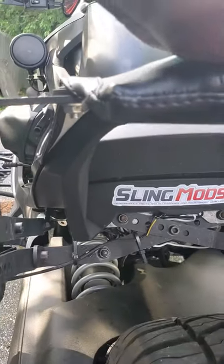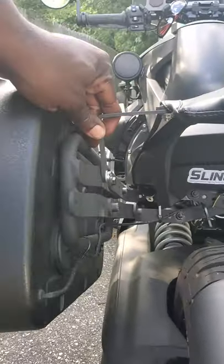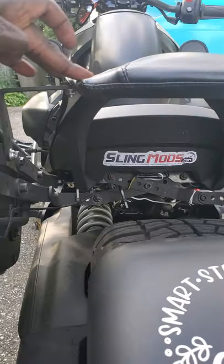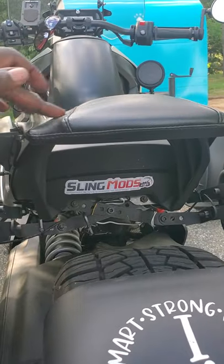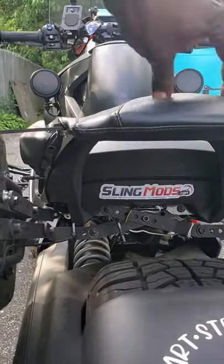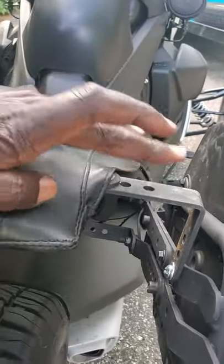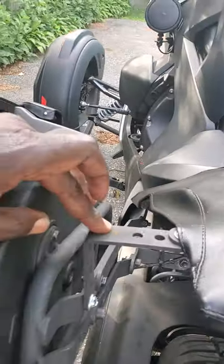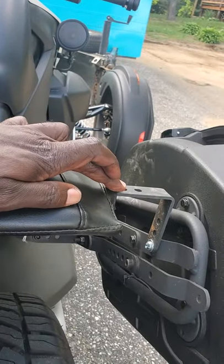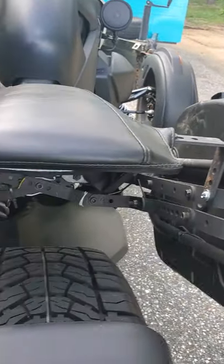The tricky part was I wanted three points of contact. The max mount has L-brackets that come down and connect to the bag, and across the top there are two long pieces. I drilled holes through the max mount so I could go nuts and bolts on the bottom to hold it in place, then bought more bolts to attach the L-brackets to those two pieces on both sides. Everything connects across and down — there's a little bounce but not much, and the swing arm is clear so nothing touches the tire.